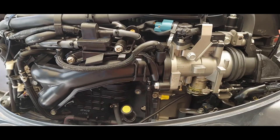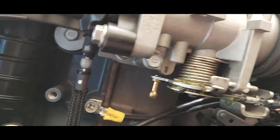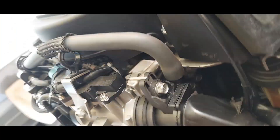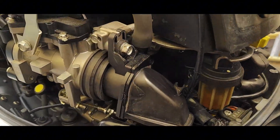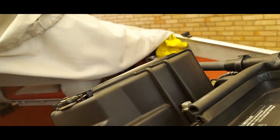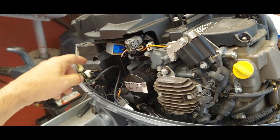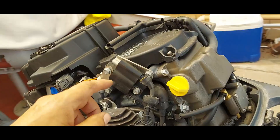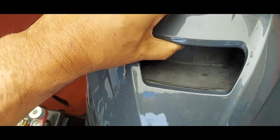When I pulled the cover off the cowl while the engine was running, I noticed — I never paid attention before — that the air intake is tiny and very narrow and restricted. Look at that, it's about an inch in diameter. The air has to come in through here, come around here, into the top of the cowl. So the air doesn't have a straight shot — it's got to come in through the back of the motor.